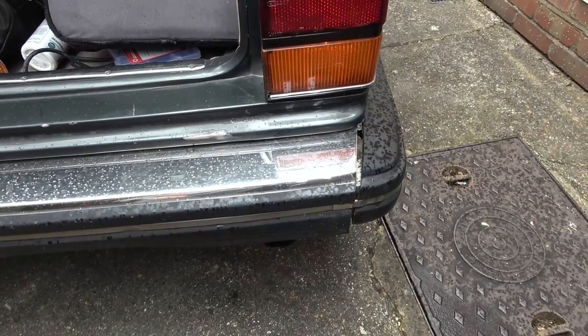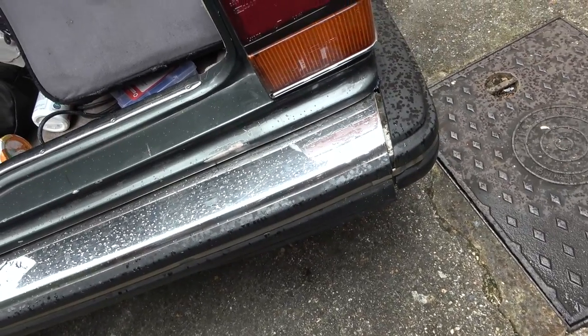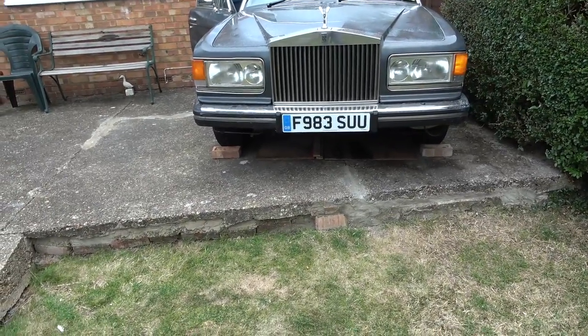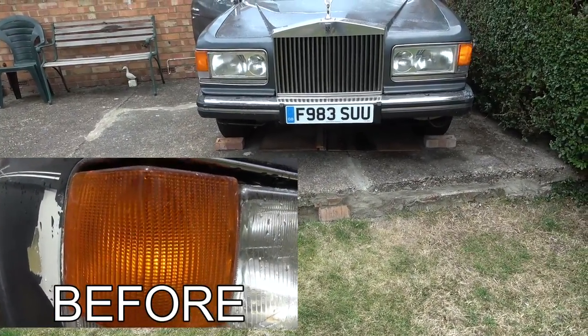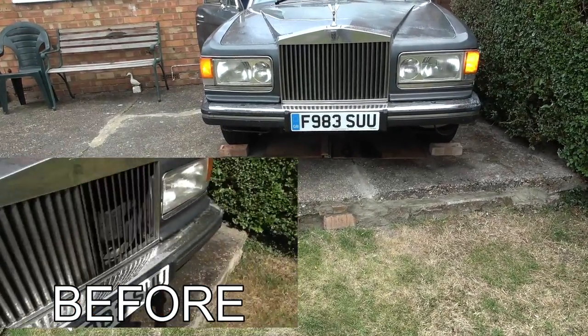I don't think that is quite as strong. Could be the bulb though, as that side there. I would say that's slightly weaker. One second, I'm just going to double check the front. Yeah, that side is still dimmer. That left hand side is weaker, unless of course it's different bulbs, or maybe it's a relay for that side or something.